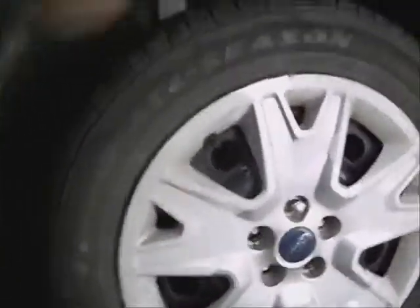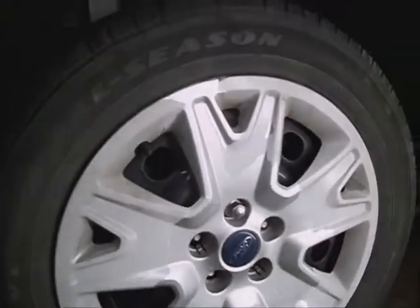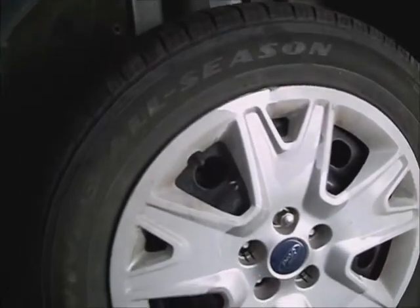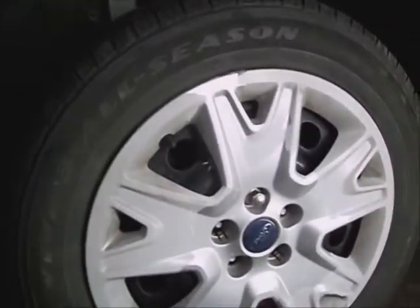Do the other side. Be sure to apply the brake pedal about halfway, three or five times, until you've got a full pedal before trying to move the vehicle, or you may end up going in a direction you can't stop.